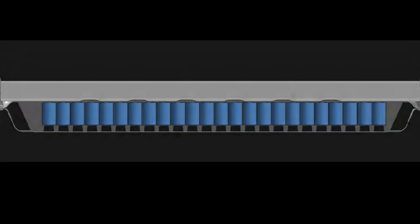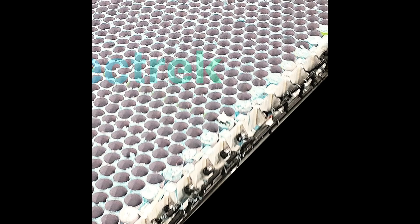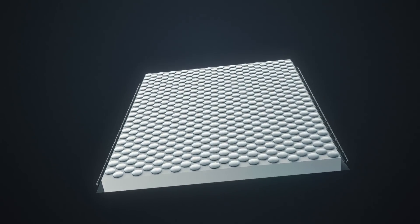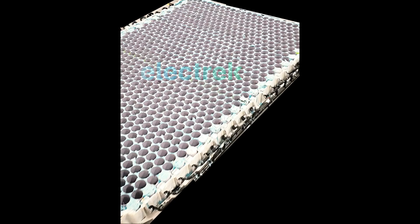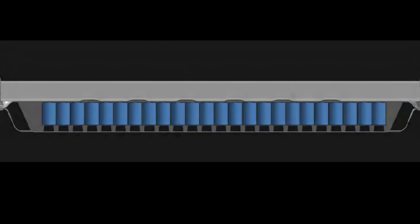This is a good place to point out a similarity between Tesla's illustration and the honeycomb structure that was leaked. Notice on the right side of the honeycomb structure that there are triangle-shaped metallic retainers with the point of the triangle facing up. If we inserted cells skirt-up and flipped the whole thing over, the point of the triangle would now face down with the broad side up. Compare this to Tesla's image — the broad side of the triangle is up, and if you look very closely you can see the positive coin contact on the top of the cells. One counter-argument is that the triangles could be coincidence and Tesla's image is just a rough illustration — there are discrepancies like unequal spacing on the left and right — and I may have read too much into the connection.